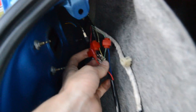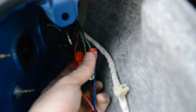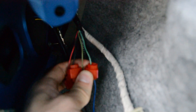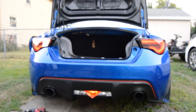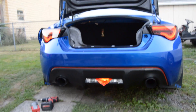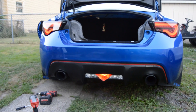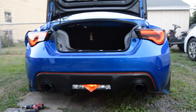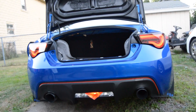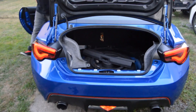The final step is using these little wire pinchers right here — you run both wires through and then pinch them down with pliers, which connects both wires so the new light is connected to your old light. Once that's all hooked up, it'll look like that. With the running light on, and when you hit the brake it lights up along with the other lights — it looks pretty sick. We'll put everything back together inside the trunk and show you the final look.